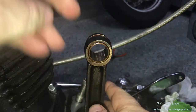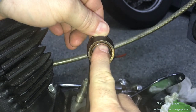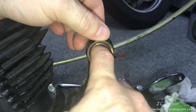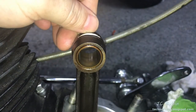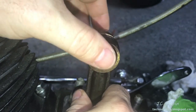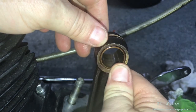Here is a smoking gun. This bushing for the wrist pin is not looking good at all. You can immediately see it's completely out of round — look how much meat is on top versus how much is on the bottom, about half the thickness. Look at the amount of wear inside — this is all completely rubbed away. That would no doubt explain what we saw before when I put the piston in sideways and was able to wiggle it. That up-and-down could translate to a wiggle — that could be our piston slap right there. This looks absolutely terrible and would need to be addressed. This is the smoking gun.